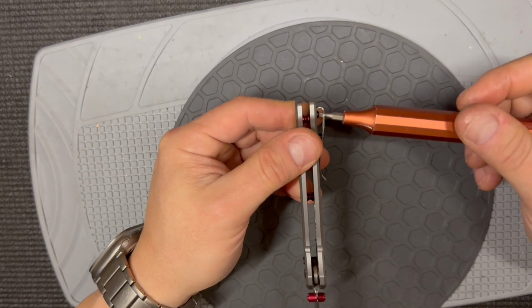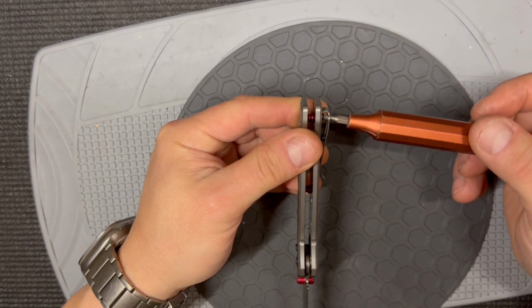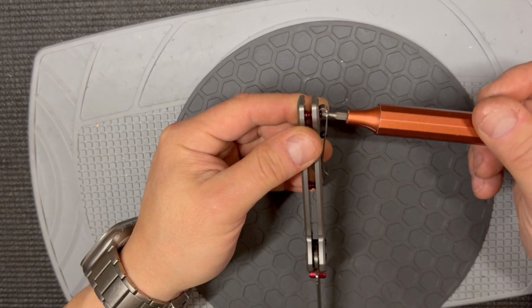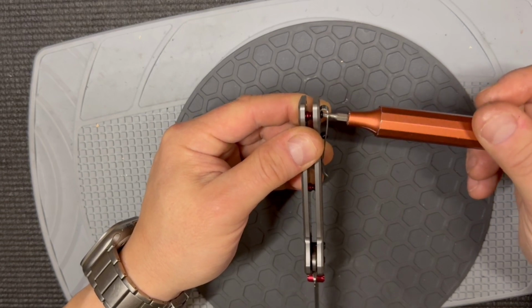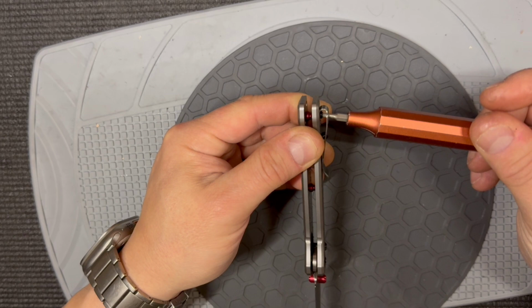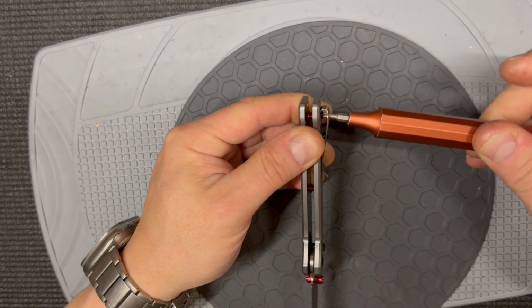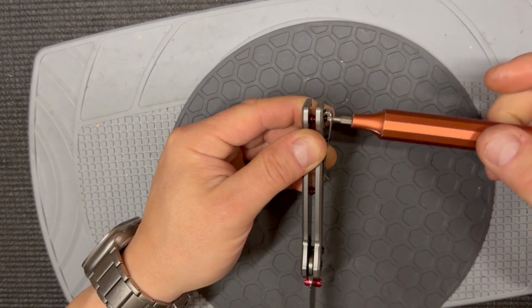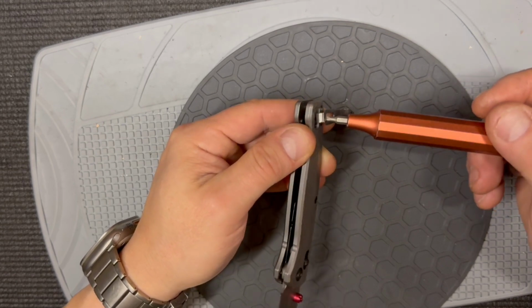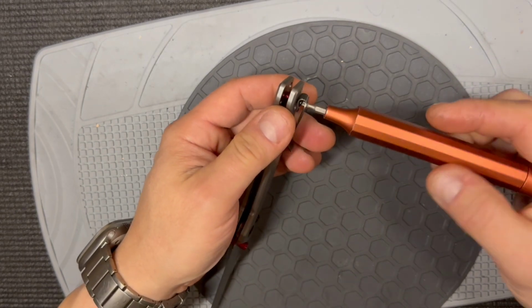You can see here, that's the angle that the screwdriver comes in at. It's a pretty severe angle. I'm gonna say maybe 20 degrees. Let's cross our fingers. I want to see if the screw is not too tight. I feel like the bit is still catching the socket there. It's a T8, which is a good thing. It's T8 all around. Okay, all right, so I'm able to unscrew it. Whew. Okay, it doesn't seem like it damaged the screw.